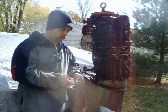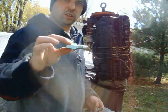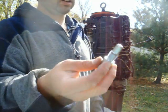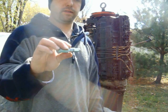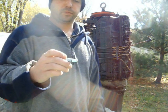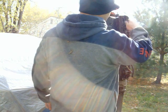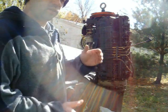I had purchased something by recommendation of a friend of mine — it's this. I don't know if you can see what that is, but that replaces this. What it is, is a Stihl or Husqvarna piston stop tool, and you can buy them for about $4 or $5 online. I found mine on eBay for $10 shipped. What you do with it is you take your number one spark plug out and thread it in the place of it. It'll only allow the engine to rotate so far before it hits that stop.